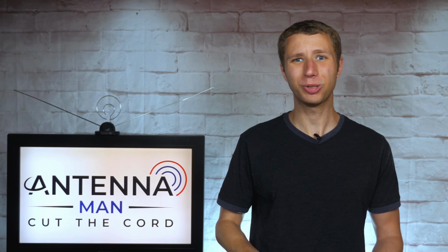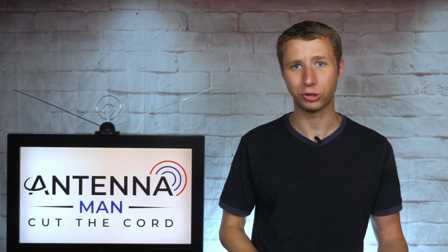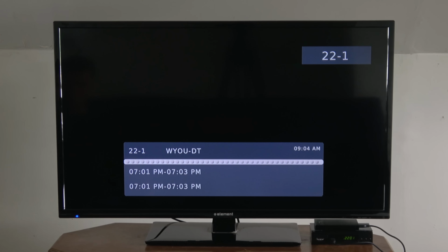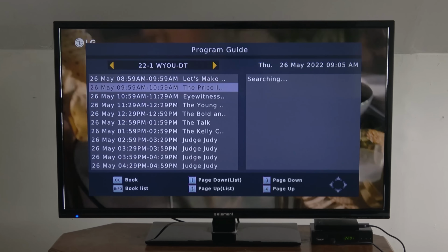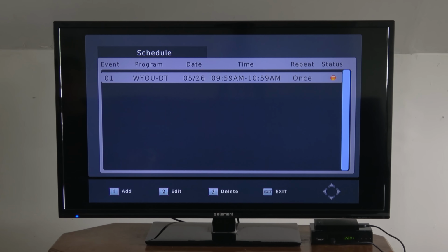While this may seem absolutely great, it may not be reliable due to a glitch I discovered. Sometimes the converter box will remove channels from the list for no apparent reason. You'll see here that it removed my channel 22 for really no reason. Running a channel scan brought the channel back, however this deleted all of my scheduled recordings, requiring me to manually add them all again. The same thing happened when I turned the box off. I lost all the scheduled recordings again.